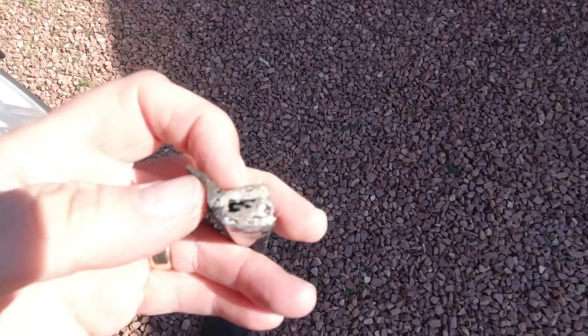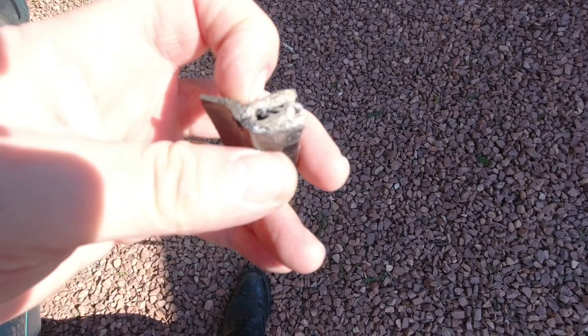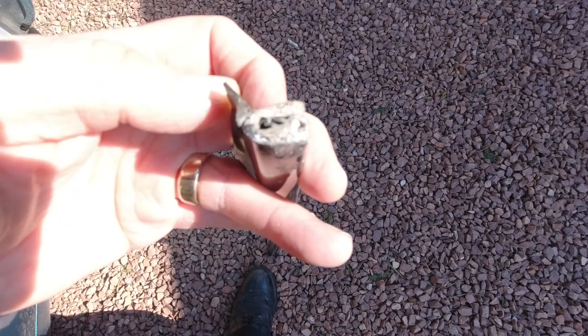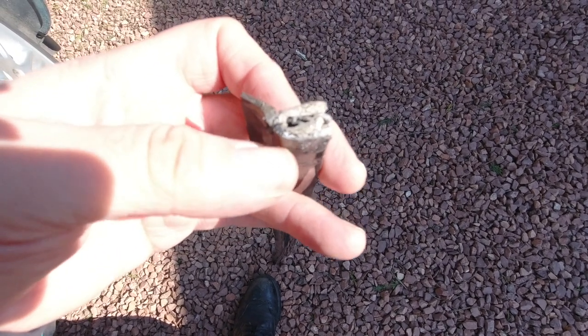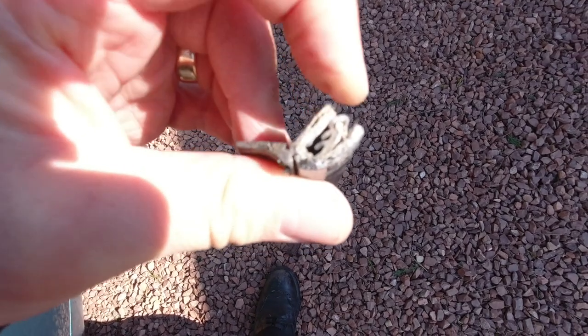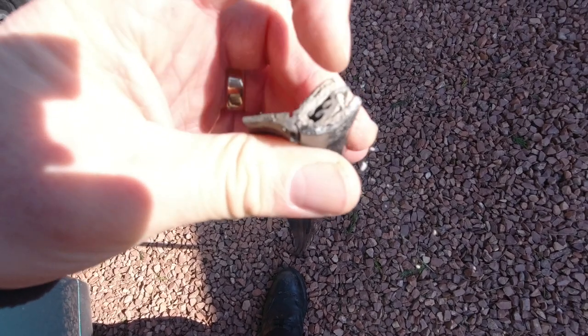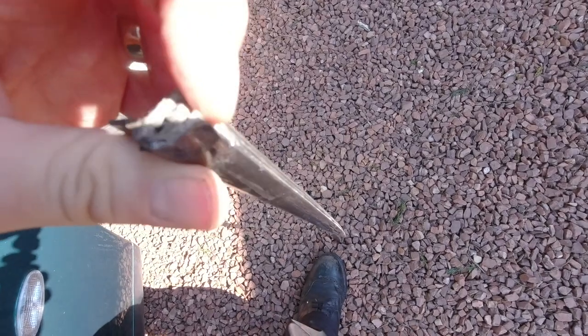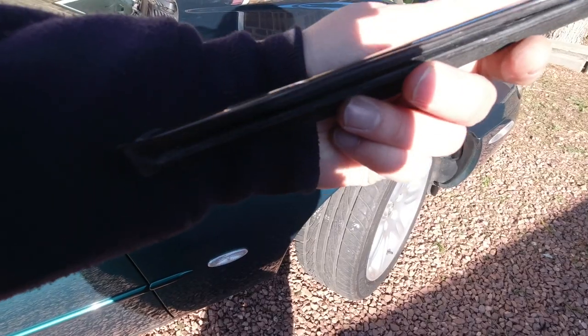The section is actually quite complex. Here's the wiper blade — the bit that touches your glass — it's undercut so it can flex, goes over the top of the metal trim piece, then fits inside it and is originally clipped into place by a little barb. But the corrosion pushes that away, and you can see all the white debris coming out. These things fail on a regular basis.